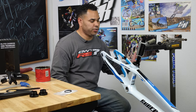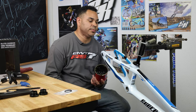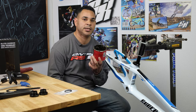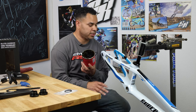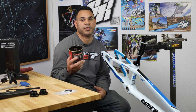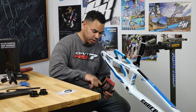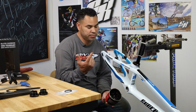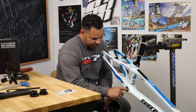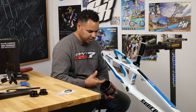So we're going to walk you through an install here. This is just a Carbon Vision frame, one of the nicer frames out there. When it comes to installing cranks, you want to grease every moving part on your bike. It's going to protect the threads on the frame and also make sure everything's running nice and smooth. So don't be scared to use a good bit of it — you can always wipe up any excess. Just go ahead and get liberal with this. Use a finger, a shop rag, a q-tip, anything like that, and just dab the inside of the frame. Make sure that you get it just about everywhere — it's really just going to protect those threads as well as keep everything lubed.